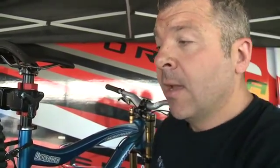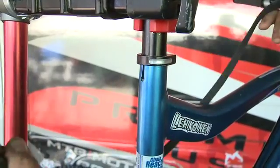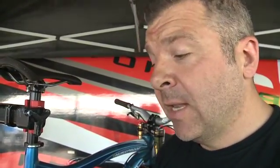Double check that you've still got a small amount of free movement in the actual mech, then relax the suspension again, remembering where you need to cut the chain. Push the link out and rejoin at that point where you measured, and that'll give you your absolutely perfect chain length with no disruption of your suspension travel.